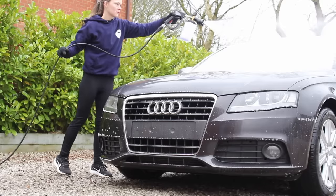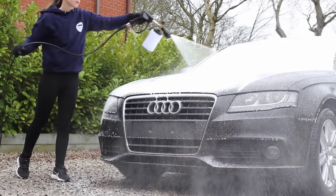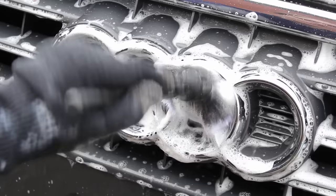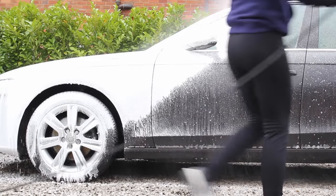The first thing on this list is using detailing brushes to get into intricate areas like around badges during the snow foam stage rather than during the contact wash stage. I was guilty of this a few years ago — I'd snow foam the car and then use that dwell time to brush those intricate areas. The problem is that at that point the car hasn't been pre-washed properly, so there's loads of dirt and grit still in those areas, creating a much higher risk of scratching the paintwork.